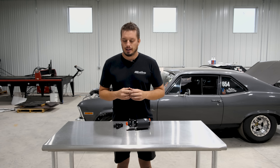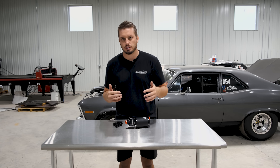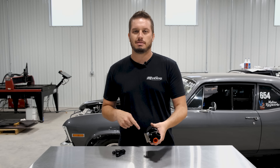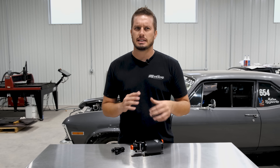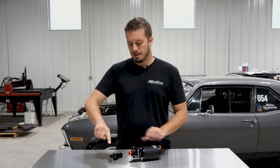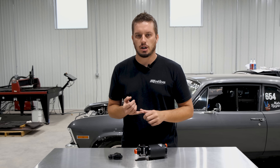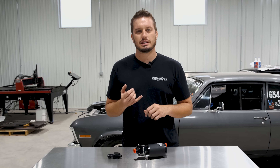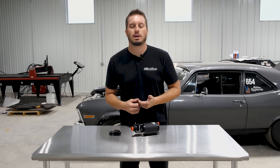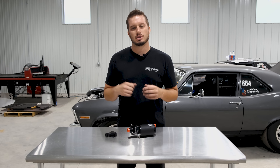Y them together after the pumps. The next thing to consider: if you aren't running both pumps at the same time all the time — say you're doing Rocky Mountain Race Week, Drag Week, or just cruising — if you run one pump, you're going to backfeed through the second pump. The cavities in these pumps don't have check balls. Almost all external aftermarket pumps have no check ball. So the fuel is going to come out, go into the Y, and come right back through the path of least resistance. That causes pressure problems and cavitation. So if you want to run one and turn on the second at the racetrack, make sure you put a check valve in line with the pump that's not being used at all times — and that will solve all of those problems.